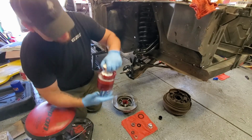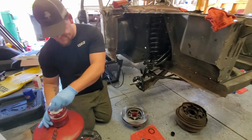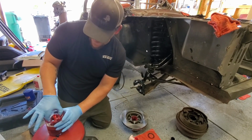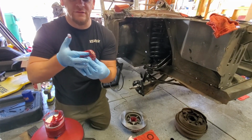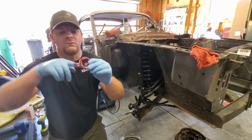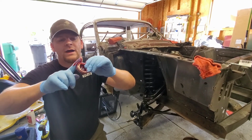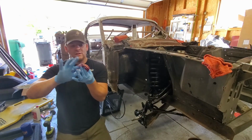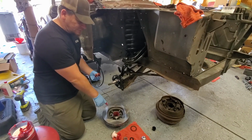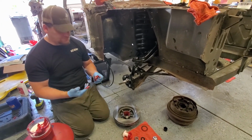So then, once it's screwed down, push down on it with your foot, whatever. That is a nice glob. It's coming out the side. Take this back off. So messy, so good. So we take that excess and pull it around the outside. Want to make sure there are little channels in here so that when we push down on it, it pushes the packing grease, and this is just all-purpose packing grease, up through each and every one of these little bearings. We want to make sure we get the outside pretty good. Now, we've already packed the new rotor assembly. We just globbed the shit out of it. All right, tons of globs.